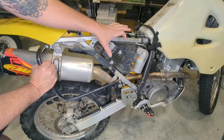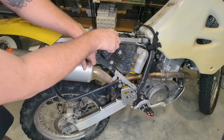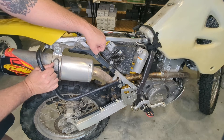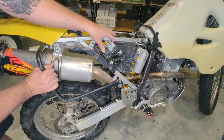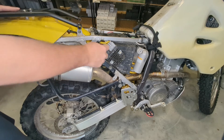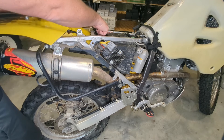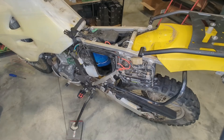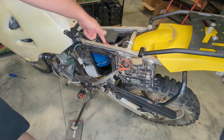We put it right here against the flap that seals the exhaust and fender area away from the airbox. The regulator is mounted with hardware directly through the airbox, with a nut and washer on the inside, and we sealed both holes with black RTV silicone so no water or dirt gets into the airbox. This makes for a really nice installation location. You can see the harness is routed underneath the frame and runs up here.